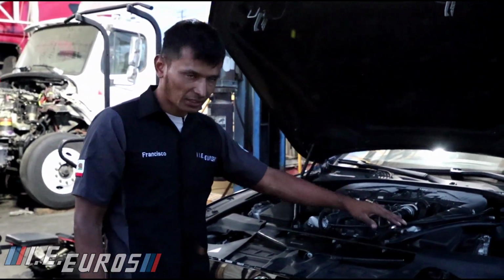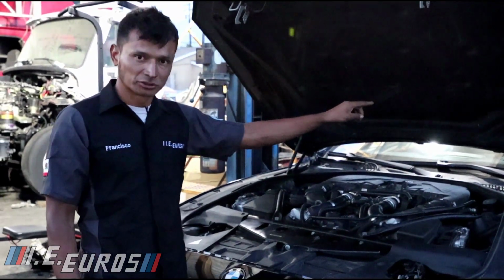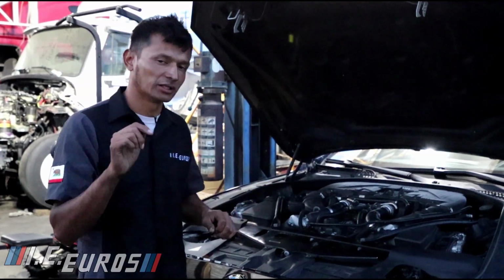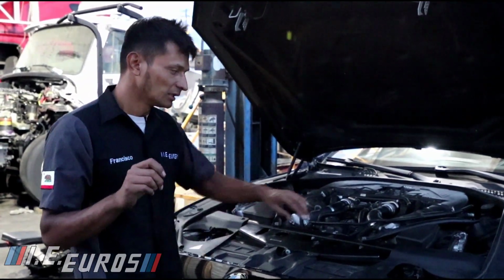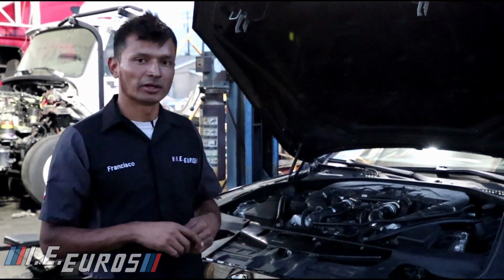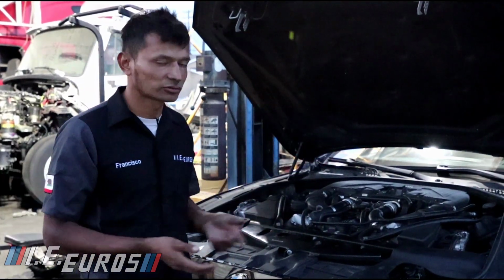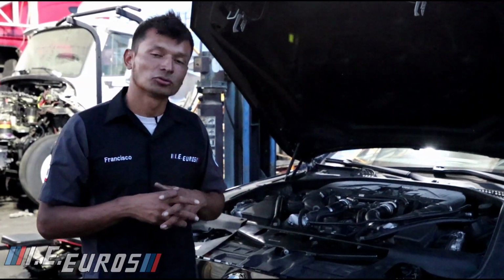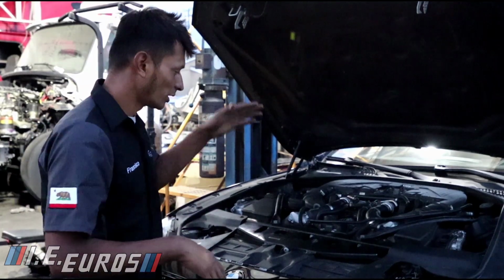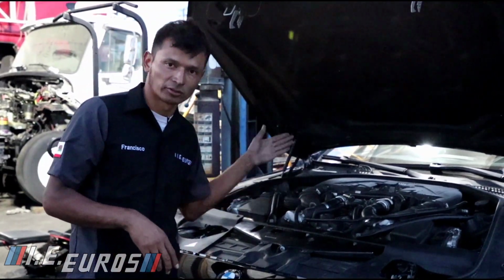Once you connect the system, which is going to be turning on the ignition only, then you're going to have a closed circuit, and that is going to be a signal, probably like 0.01 volts or something like that. So you're going to know then the circuit is closed. So if that is the case, we are going to replace the boost solenoid.